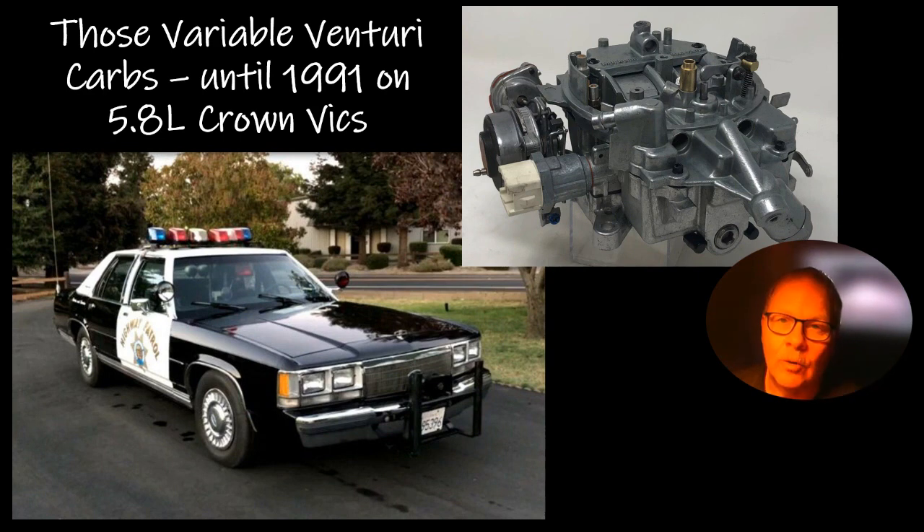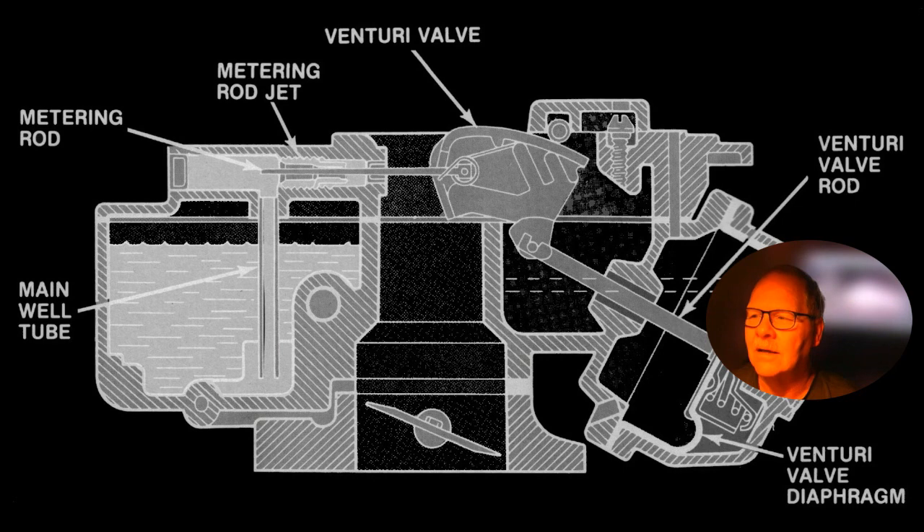The mechanical linkage on these carburetors had to be depended on to pull the Venturis to wide open throttle, but the way they were set up, at wide open throttle you only had about half movement — they would stop about halfway back instead of going all the way. The vacuum diaphragm on these liked to bust a lot; we had to change them all the time. You'd just hook it on there, take the screws out, put the new diaphragm in, pull on it to make sure it was moving the Venturi, and put it back together carefully to keep vacuum trapped in there. This carburetor was really pretty simple — a tapered metering rod would be pulled back, more air allowed in, fuel drawn through the jet and misted in.